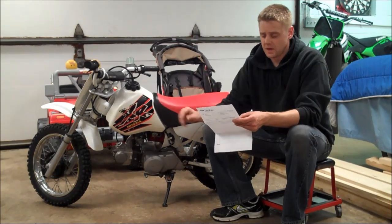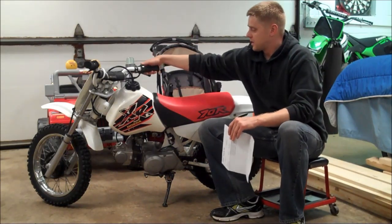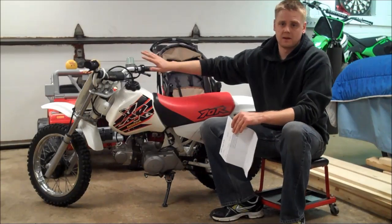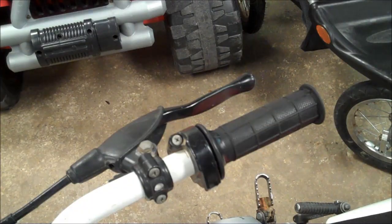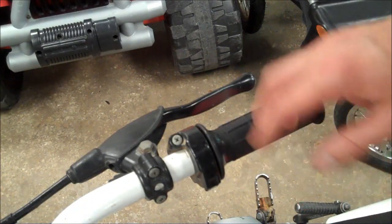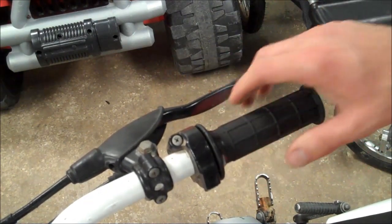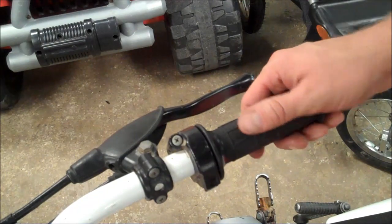The engine has to be in good tune. Another thing I like to do is mark the grip from zero to 100%. I'll show you that in a second. So for the main jet, it doesn't really matter because you're holding it wide open against the stop. But if you're tuning other circuits, here's a quick tip for you.